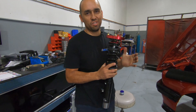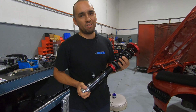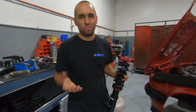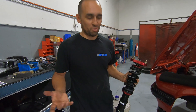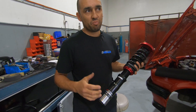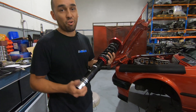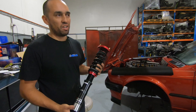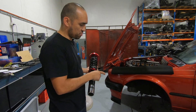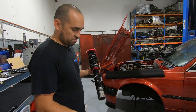On this episode, one of the things we're going to address is the suspension. We cannot go past upgrading the suspension on this package — we want the car to drive and handle better than it's supposed to. What we've got here is a set of BC Racing coilovers. These are very popular here in Australia, and we've seen great successes in time attack and drifting. We're very lucky these are available for our size — we're running the 45mm struts from the factory, so it's easy and convenient.